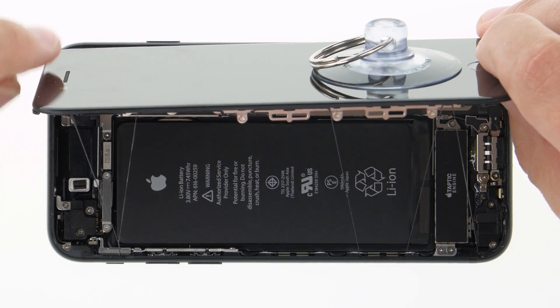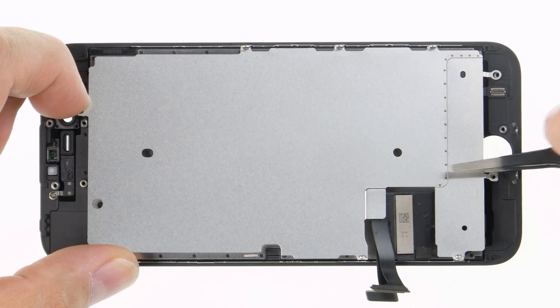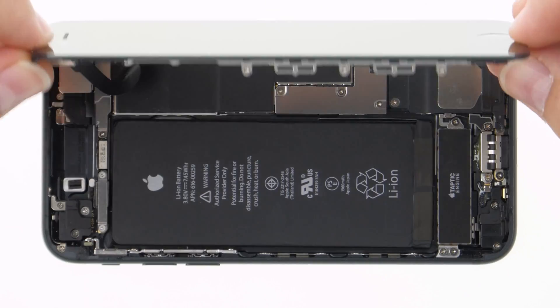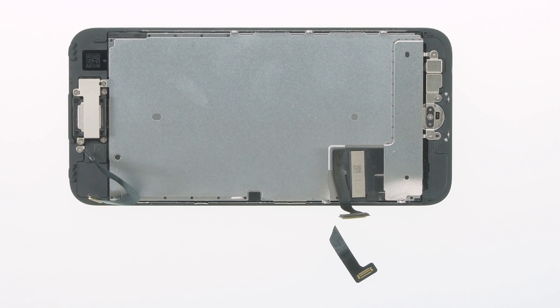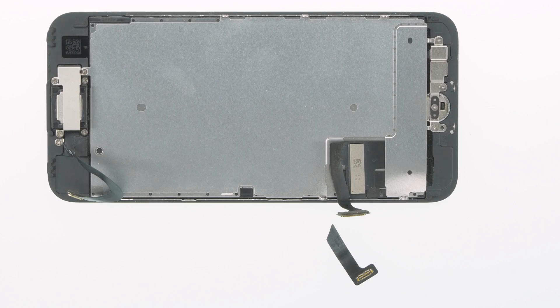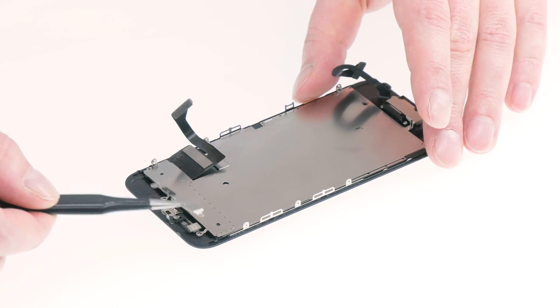You can watch a video guide to replacing your iPhone 7's display on our YouTube channel, or use the step-by-step photo guide on our website, iDoc.eu. Now I've removed the display. The Home button cable isn't working — you can clearly see that it's torn. Because it goes through the backlight, we're going to replace the entire backlight.